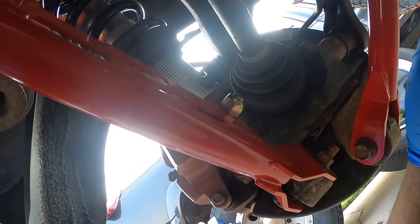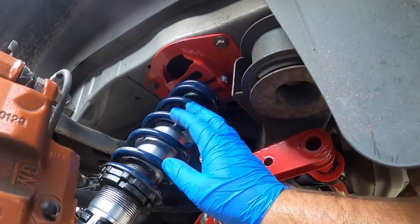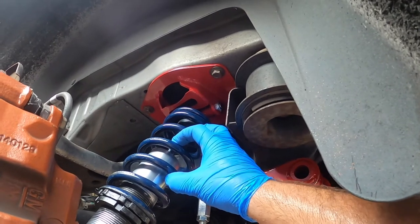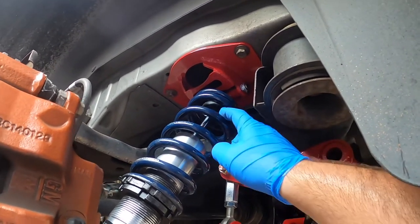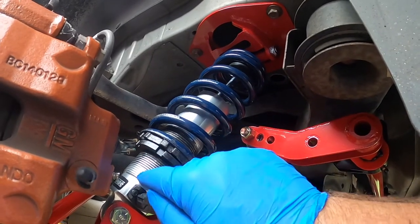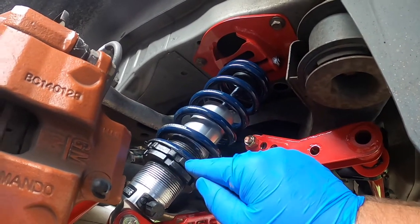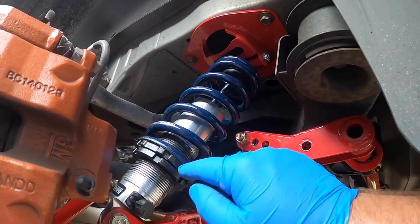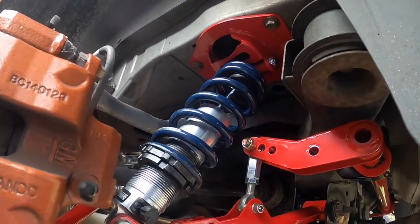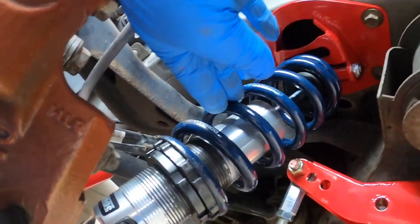Let me run through the rest of the procedure. The last thing I showed you was sliding the spring onto the body of the shock and building it — fairly simple. One thing you definitely need to do is put anti-seize on these threads. Do not run these things dry — this is going to bind up into that aluminum and you're going to ruin it. Plenty of anti-seize even on these because it's metal on metal, and when you rotate this it's going to dig into your spring. Put anti-seize anywhere to keep it lubricated.